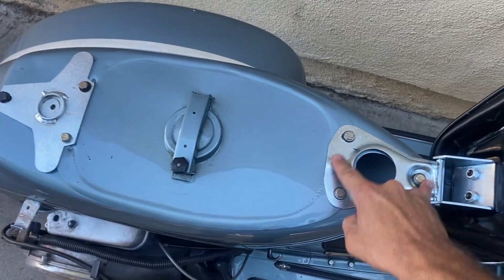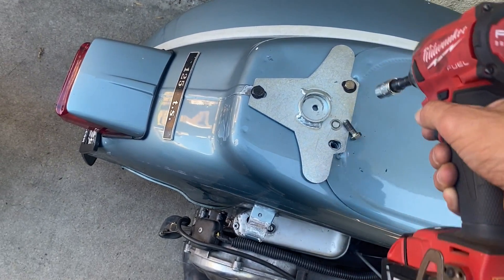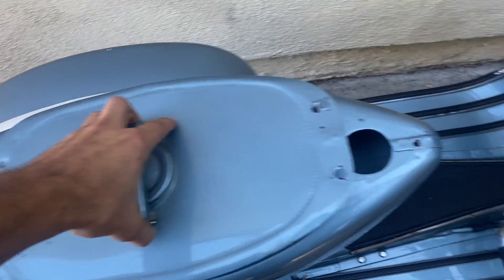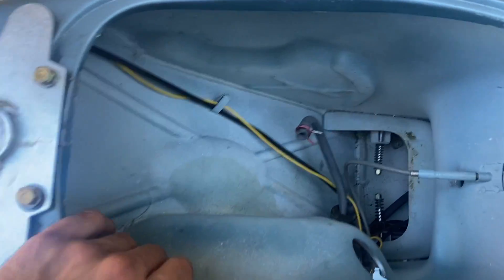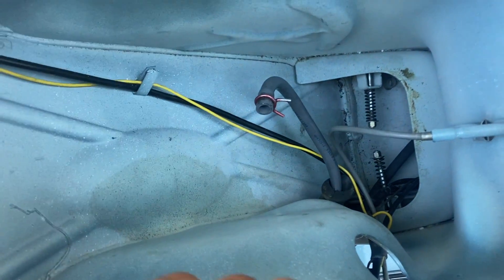To remove the gas tank, it's pretty easy. We've got to remove the seat and remove this back rack — this is actually a modified magnet seat. It's an 11 mil, and we're just going to get those removed. To remove the tank, you do need to take out your fuel tap and your choke cable. The best way to do it is to lift up your tank and get in there — you can see all the connections down there, and you do need to disconnect those. It's not the easiest thing in the world. Gas tank is removed. Put it on a towel just in case you don't want to scratch it up. Hopefully if you're doing this, this is what the inside of your gas cavity looks like — super clean, really nice, no rust, no dust, no spiders or anything.